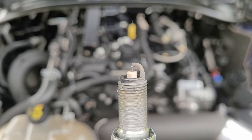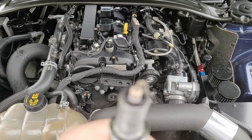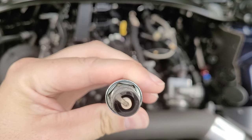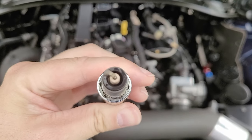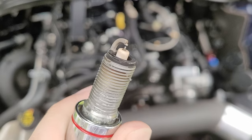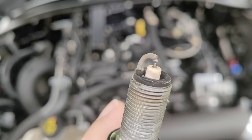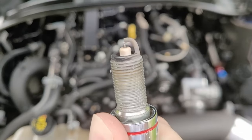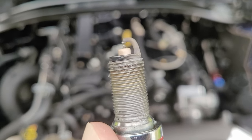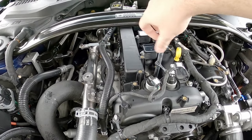Check that out. Look how the backside of the spark plug is all clean. Oop, focus. There we go. You can see some of the carbon getting eaten away there. Wow. Notice how the insulator looks. That's a lot better looking. It used to be really white because I was running on the leaner side, and now it's looking nice and healthy. That's a good looking spark plug. Also, don't worry about all the junk in the threads. It ain't looking too bad now, is it?